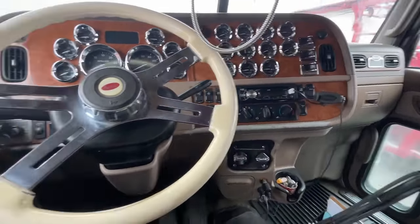When you are coming up to an intersection, this past example where I just jake down and I'm parked, I don't need to be in a gear again. When you're slowing down to an intersection, say you're in fourth gear when you get to the intersection and you stop, then you leave the clutch in, shift over to your gear, and that way, you want to leave it in gear clutch in until the truck is actually stopped, so it stops the transmission at the same time, and then you can find your beginning gear easier that way.